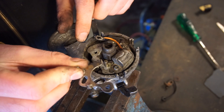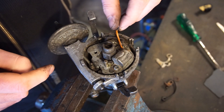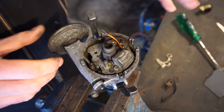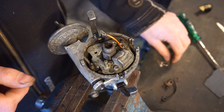And then you have the base part here, which moves back and forth on the adjuster here to adjust them. I'm not going to remove the condenser right now, but it's just that little screw there that moves out. This will of course be different on different distributors, but the whole idea behind it is pretty much the same.